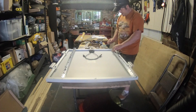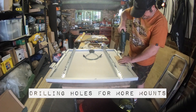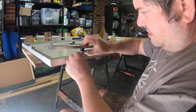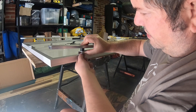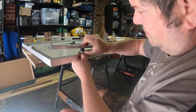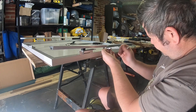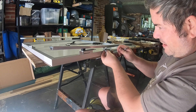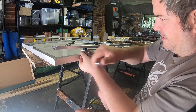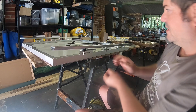I will now need to shape them and give them a little bit of a curve to make them fit the roof. Then I will attach them to the solar panel, apply some Sikaflex, clean the roof, and drop the solar panel assembly on there. You can see the rubber spacer that I'm using here to accommodate the curve in the cargo rails. Tighten that down and it forces the curve, then I can tighten the rubber one down and make sure I've got the right curve.